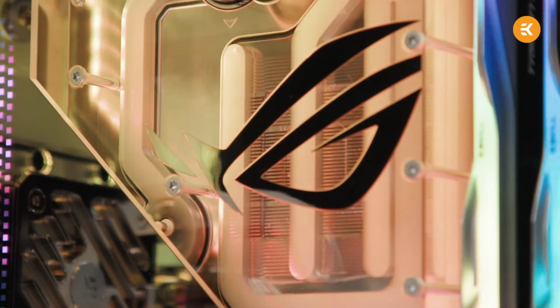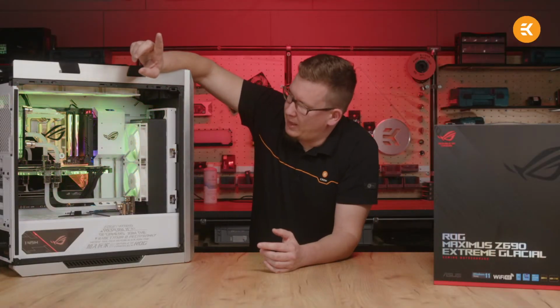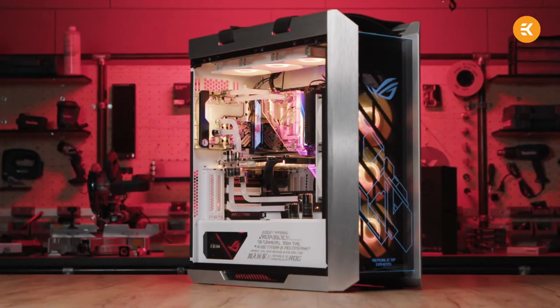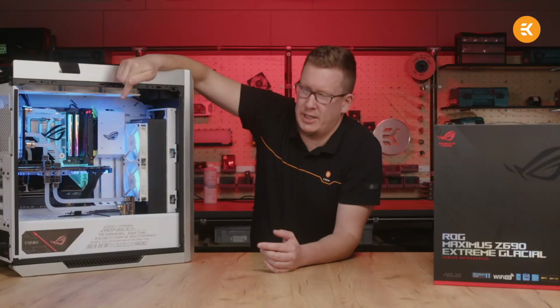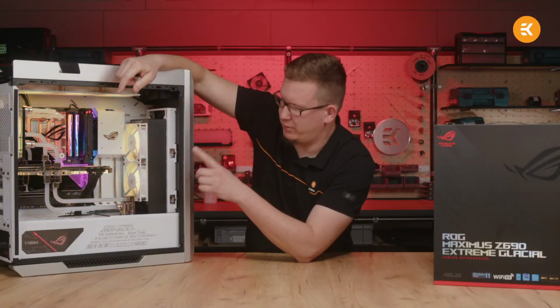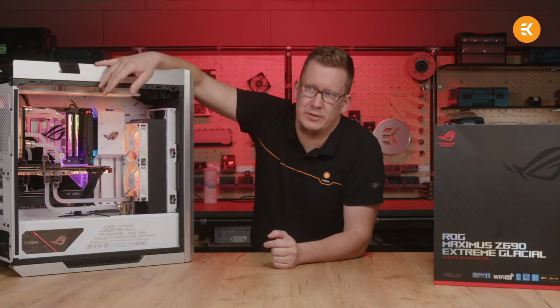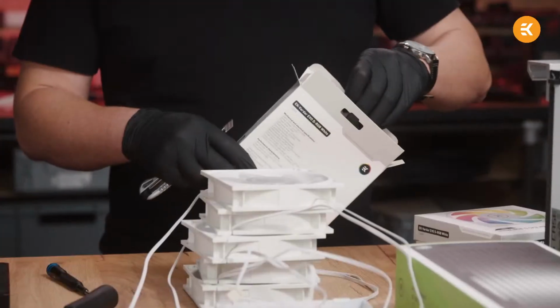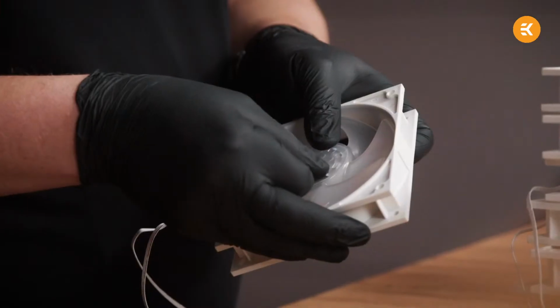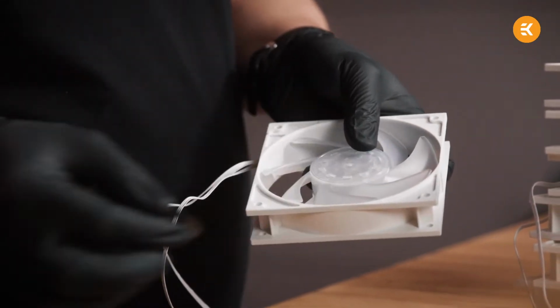It would work better if I had the motherboard connected as it is, and if I would go with the other loop in series, so from the GPU to the radiator and then from the radiator back to the GPU. Yeah, so it would actually, no, from the distro to the GPU to the radiator, and from the radiator back to the distro. That would be more efficient. Yes.